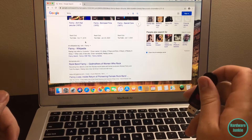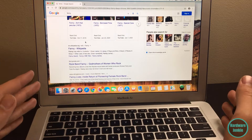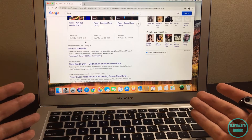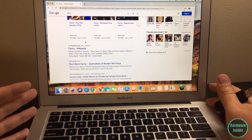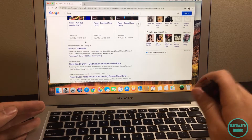We're putting CPU monitoring software on this machine because we have no idea what the CPU temps are - just to check and see if the CPU is actually getting really hot. If it is, that means we probably just have to clean the thing out. But if it isn't, it might be some sort of software or damaged hardware issue. I could see it being damaged hardware because in this back corner we've got a pretty big dent on the bottom - I'm assuming she dropped it at some point.